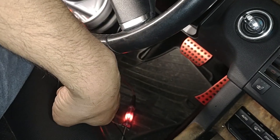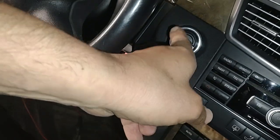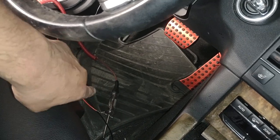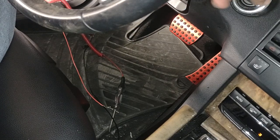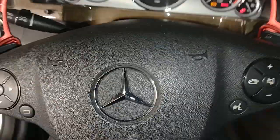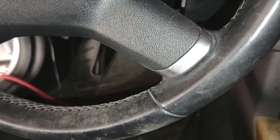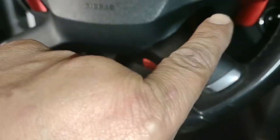As you can see, the light turns on when I turn the ignition to the start position. So the ignition, the computer, everything in between — it doesn't matter what it is — it's doing its job. As soon as I turn to start, the starter gets the power it needs. That test light is a starter simulator. So this is definitely a starter issue, and you don't have to check everything in between. This is the easiest way to confirm a starter problem, and it applies to many vehicles.